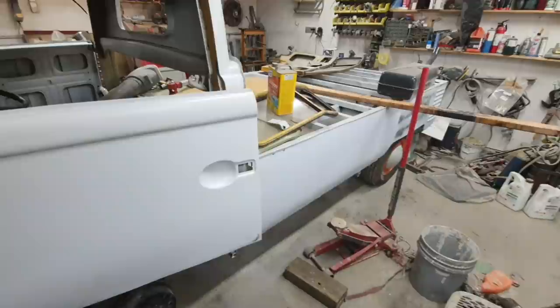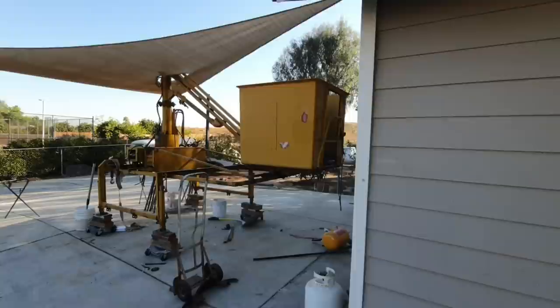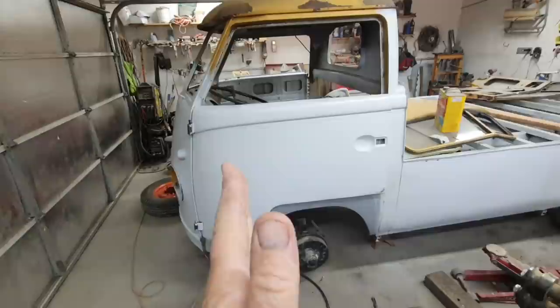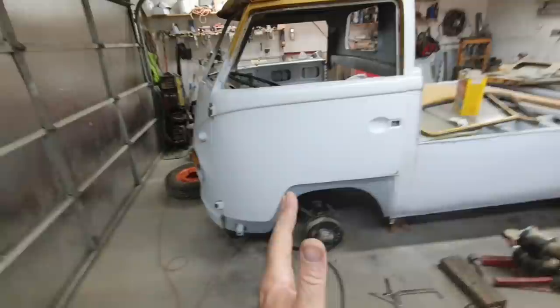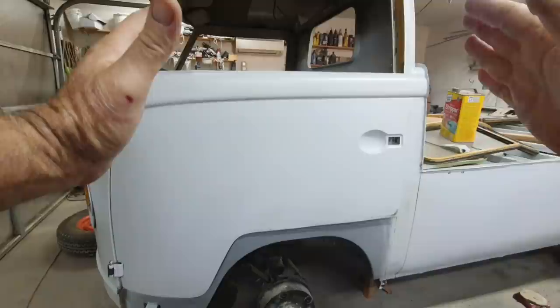It was not normally a truck that somebody would try to save, but because it's a cherry picker, a bucket truck, and it had this thing on it and it's going back on. So I don't know how that affected it. It might have made the cab stretched out a little bit, and I've got to bring it back. That's what I'm using the dog leg for, to pull it back together. And the floor, where all that section was missing, if you can imagine that being splayed, with all that metal missing, it kind of doing this. So what I'm doing is pulling it all back together.